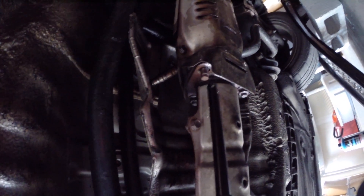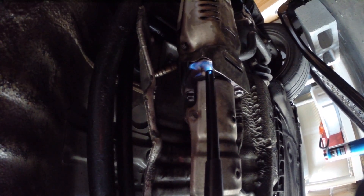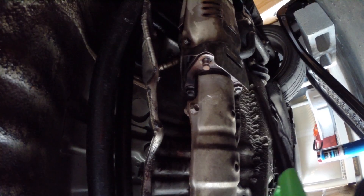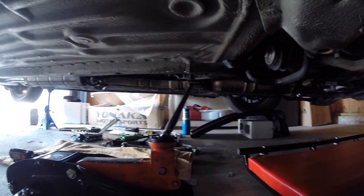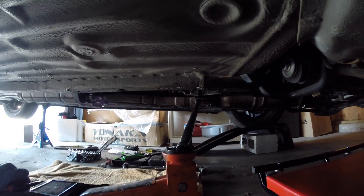This one was quite a pain. I soaked it down with penetrating lubricant last night and let that sit. Then I took a lighter and heated up that nut for a good amount of time — probably about a minute or so. Typically you'd want to use something hotter, like a propane torch or an acetylene torch. This was just a quick and dirty way — I do have a propane torch nearby in case some of the others are more difficult. After heating it with the lighter, I took a floor jack and connected it to a breaker bar on the socket, then jacked up the breaker bar until it snapped. After that I could get in with the socket wrench and take it off the rest of the way.